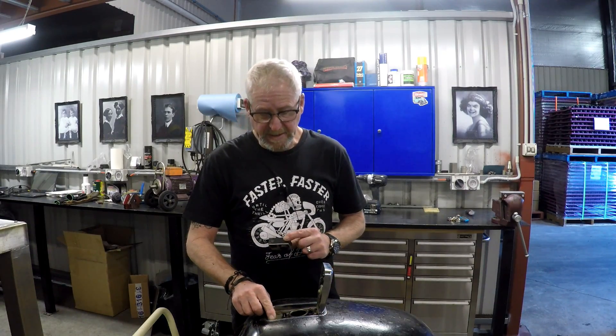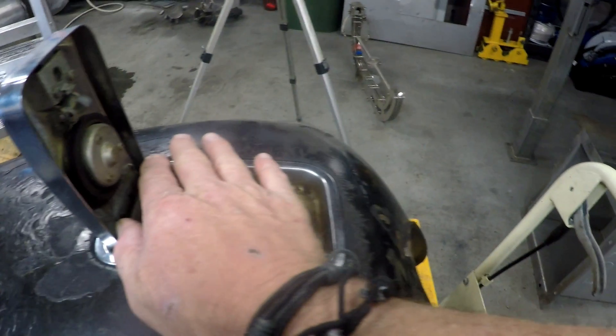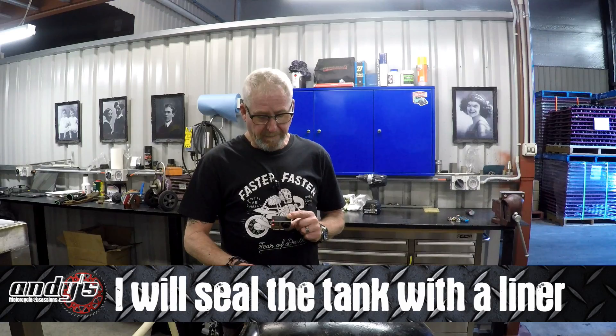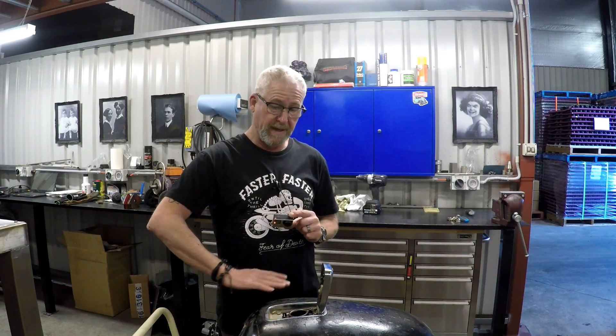The other option, of course, is to do what was done before — cut it out around here and make an infill panel, weld in the whole panel so the tank would all be flush. Obviously you sink the fuel filler tube in low enough that you have the right amount of airspace for expansion.